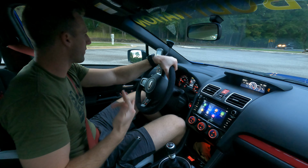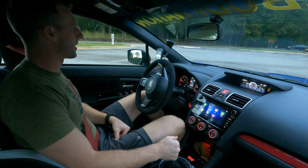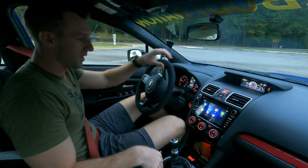Anything else you guys want? Fuel pressure's up in the 50s right now. I mean, 40, 50, it's all good. Other than that, let's rock. Like I said, we're in the high 70s for E85 content.